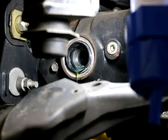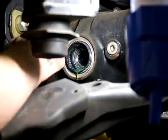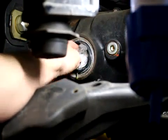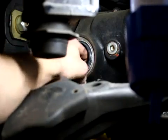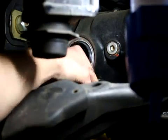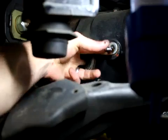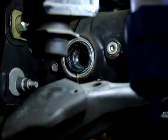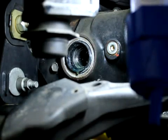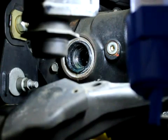It's probably a good idea to stick something down in the carrier inside the spider gear so if the tool does go too far you can get it out. I use some cellophane that I had sitting here, but you can use a paper towel or something like that. Then when you're installing the piece that goes into the carrier, you're going to want to use a magnet.